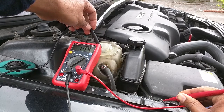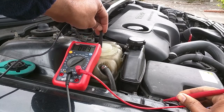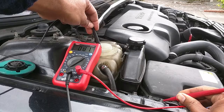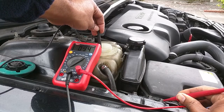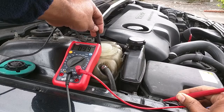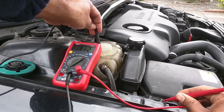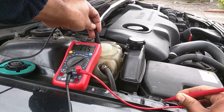And there we go — hovering somewhere around about 100 millivolts, sometimes going up to about 130. That's exactly what you're looking for on fresh coolant, because that means all of the old coolant has been flushed out. That old coolant was starting to carry trace elements of metals that were oxidising from the pipework, maybe the heater core and radiator. That's all been changed out now — got fresh coolant in there and the rust inhibitors are at the peak of their powers.